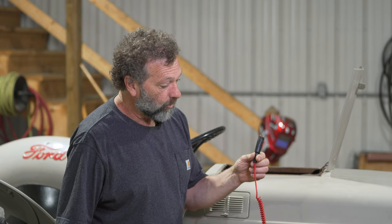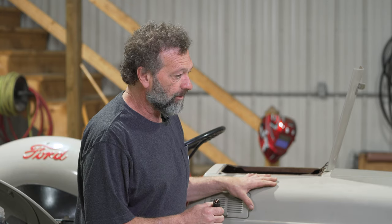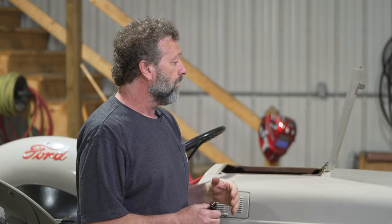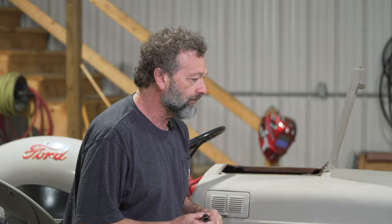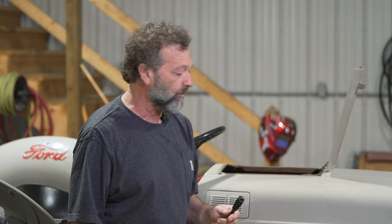Rachel and I have a test tool here — it's just a screwdriver with a light, and it's one of our favorite tools. I use this to triage quickly and determine what the problem is with the tractor. This tractor is an 8N inside distributor that's been changed to 12 volt. Probably more than half of the tractors around us are not 6 volt anymore. If yours is still 6 volt, the system still works — it doesn't matter if it's 6, 8, or 12 volt.